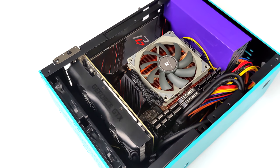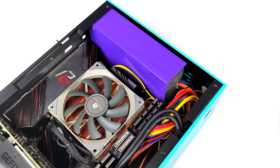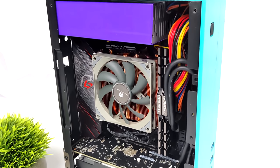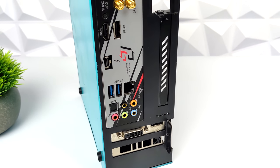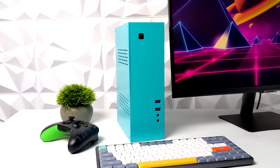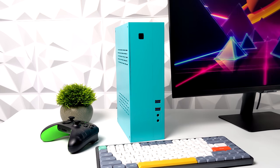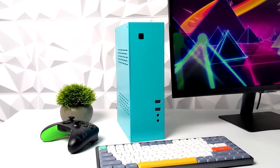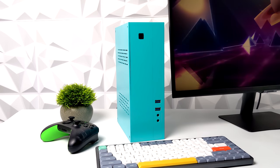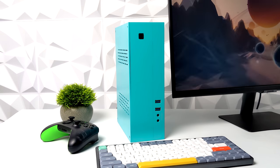Overall, this actually turned out to be a really nice little mini PC. There are a couple of things I'd like to change, like that power supply — I went real cheap with it, only 30 bucks for a 350W. The little fan in there is on the louder side, but if you threw a few more bucks at it, you can get something that's decently quiet. Another thing I would probably change is just putting a larger cooler in here — this is only 47mm, but it will support up to 63mm and there are plenty on the market that'll fit just fine. But when it comes to overall performance for PC gaming and emulation, this is a really good little machine — eight cores, 16 threads at 4.4 GHz, and that GTX 1650 can definitely handle 1080p AAA gaming. When it comes to emulation, 4K and 1440p is totally possible on this little thing. If you're interested in building something like this, I'll leave some links in the description. Thanks for watching!